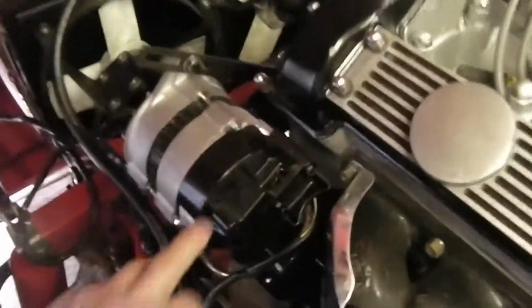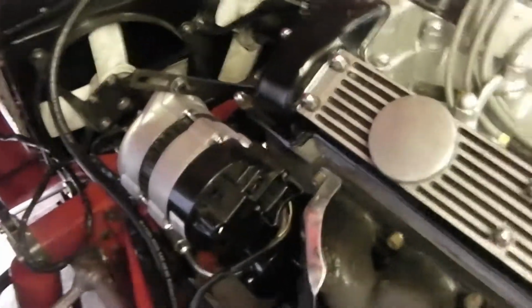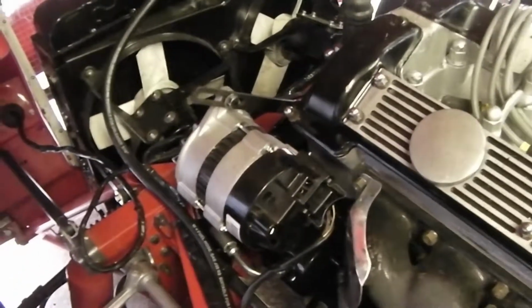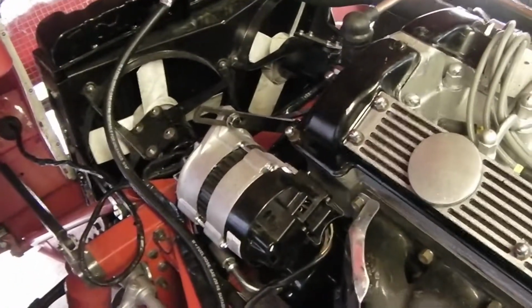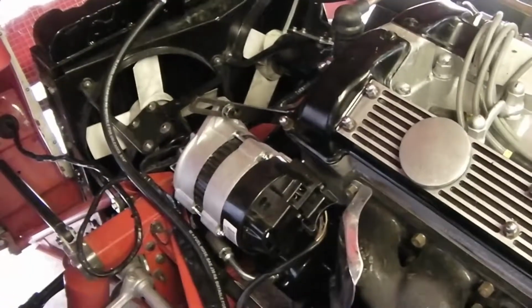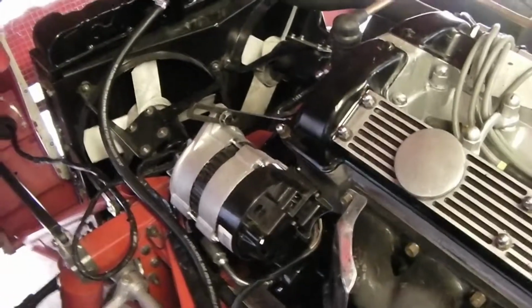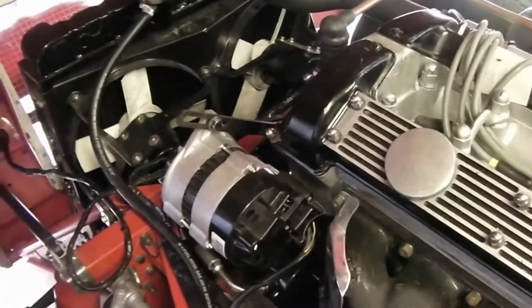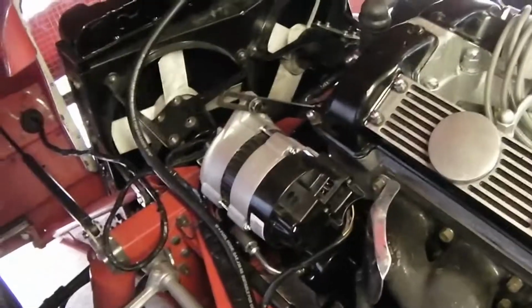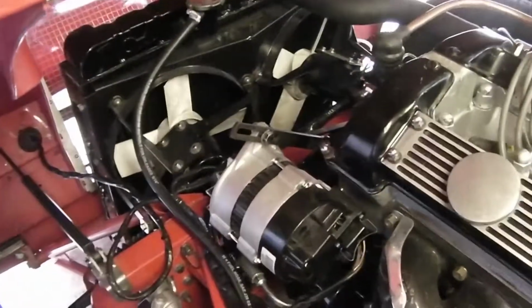I also took the opportunity while I was rebuilding it to replace the alternator with a modern alternator, which has got the regulator rectifier in it. I believe they come off a LDV Sherpa. It's quite a neat unit, fits pretty well straight on with very little modification, and it works fine. I mean, this job was complicated by the fact that this model it's a power assisted steering model. It's a right hand drive, although I do believe the car actually originally came from Canada, so things were a bit tight down in the engine bay.